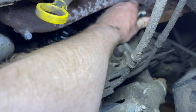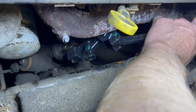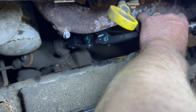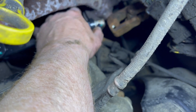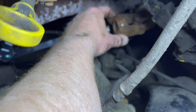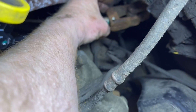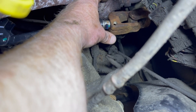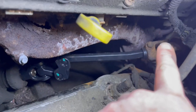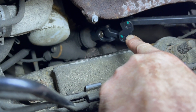Because the new part is as flimsy and flexible as it is, all you've got to do is just kind of drop it down into place on the rack and pinion. It's easier with two hands free but it just slides down there. On this end you just line up your bolt slot — it is keyed, it only goes in one way — with your upper section of your steering column, and you push it in and put your bolt in to secure. I'll turn that steering column a little bit so it lines up, then put those in. We've got our 13 mil tightened up on this end and our 10 millimeter tightened up on that end.